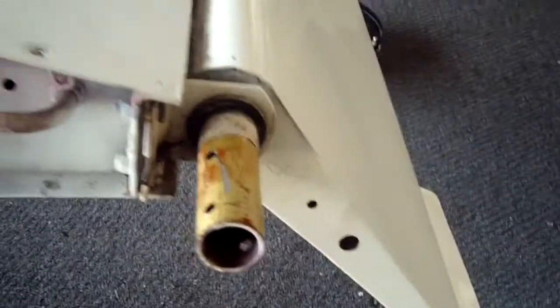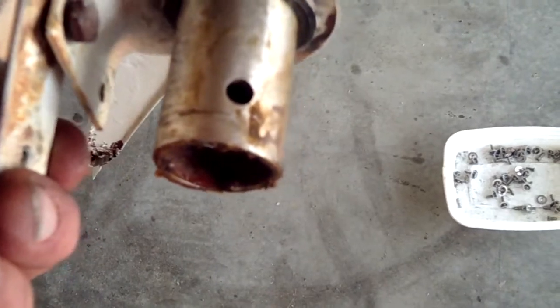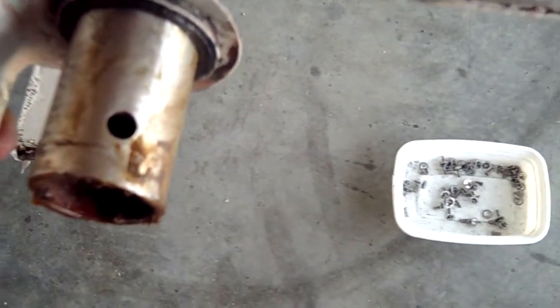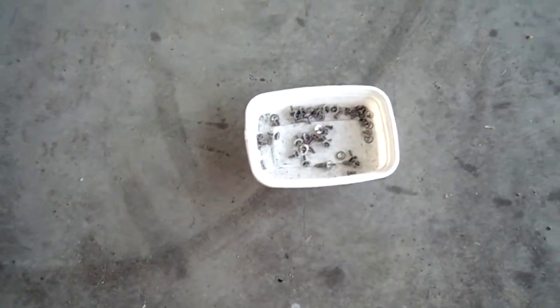Now, let's walk to the other side of the airplane and see what we see. We noticed that one spacer is in between the stop bracket and the bearing bracket. One's on the other side, and it's in the wrong position. So this stack is completely wrong. And if you look at this as it sits on the airplane, notice — top is on the bottom.